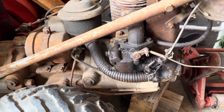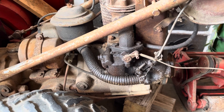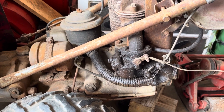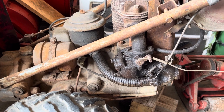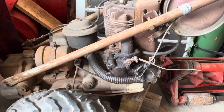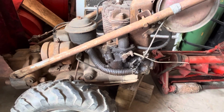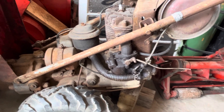Apparently the pressure relief valve is then creating the pressure that's filling oil into the oil filter, forcing the oil out the other side of the oil filter, and finally the oil goes to the engine. I can't say I've ever seen one actually plumbed up like this before, but it's not correct for low volume and it's not even correct for high volume. So I'm going to pull the filter off this, and when I start the series — probably next year — of getting this tractor running, I'll go ahead and re-plumb it and put another filter on it before I even start.